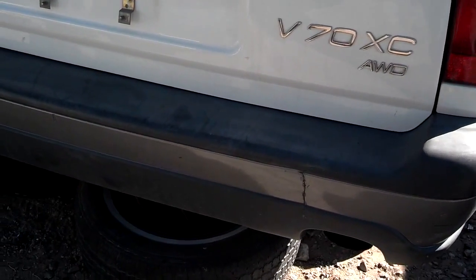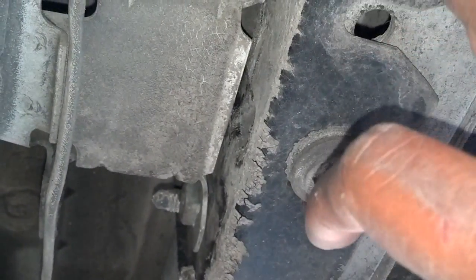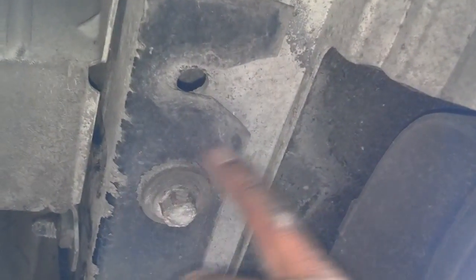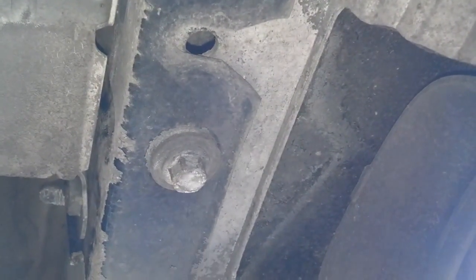In a lot of cases, you could actually walk over to the car, grab the bumper, and lift it up, and watch them rise up and down. If you come down under the car and look back up at the brackets, these are the brackets that are normally rusted out. Since they're sitting down low and this metal's resting on them, water gets trapped in there, or salt chips up this end of the bracket, and these things start rusting out because water can be retained up there. What I did when I fixed mine: I cut a groove into the aluminum part of the bumper across here, so that if water settled in there it could actually drain out, and I did replace the brackets.